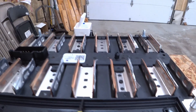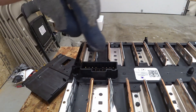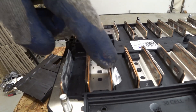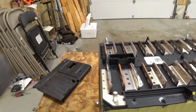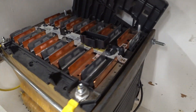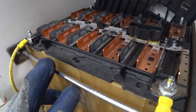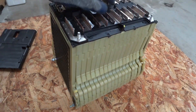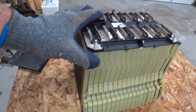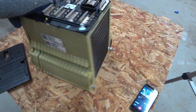Something interesting — up here is the port where the BMS attaches, and the wires are hidden underneath. Also, when you look at these silver tabs, there are three pouch cells on every bus bar. Those two things are different compared to the Gen 2, where all the BMS leads are sitting on top and there are two pouch cells for every bus bar.